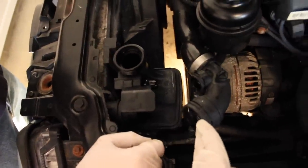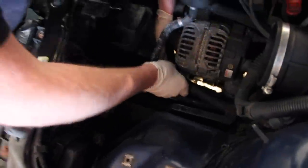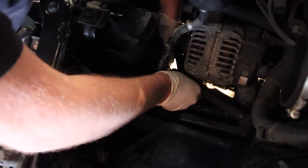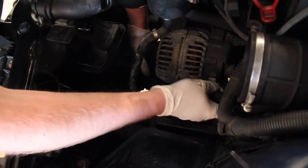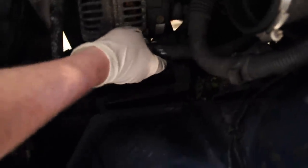That'll disconnect from the expansion tank — that's the upper part. There's another hose down at the bottom, but the bottom hose is actually serviceable from the top. Same deal: lift the clip, wiggle the hose off. That's going to drain a bunch more coolant down into your pan, so be sure to keep adjusting the position of that pan down there. You can angle the hose up to get a little bit more out so it's not dripping on your head.